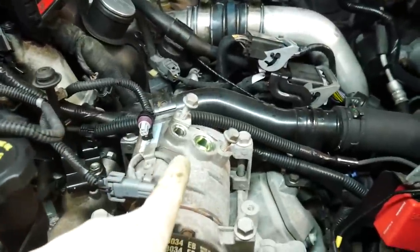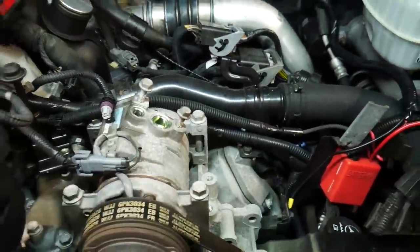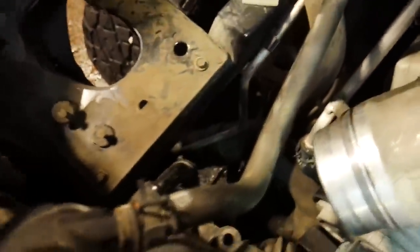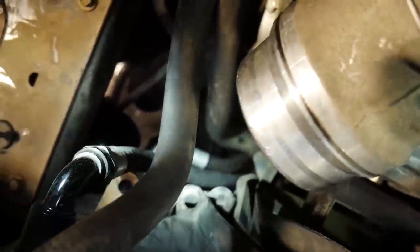So we took our AC lines off from our compressor and put the bolts back in so they can stay there. Now we're going to be taking our shroud off — 113 — and the two halves will split. There's two push pins down there and two push pins right there.